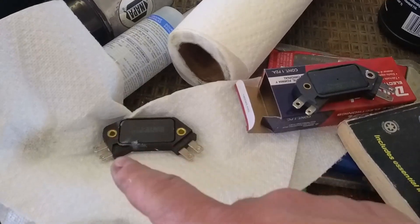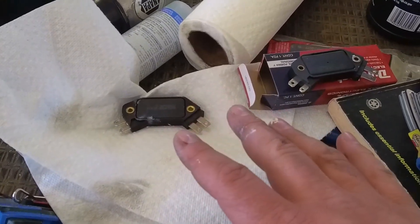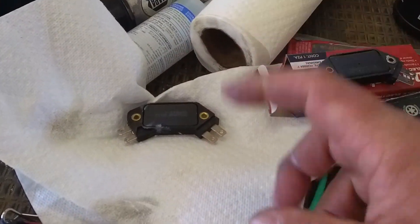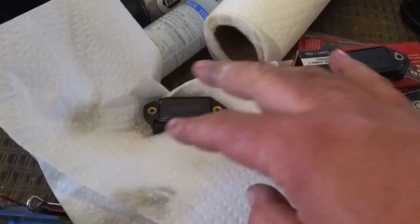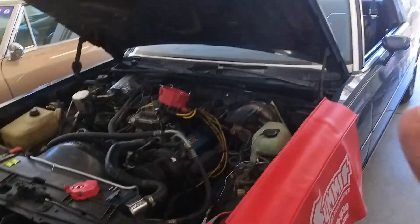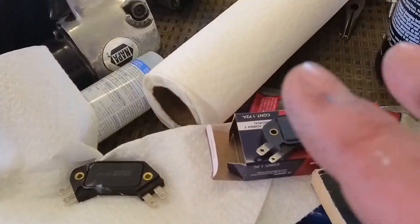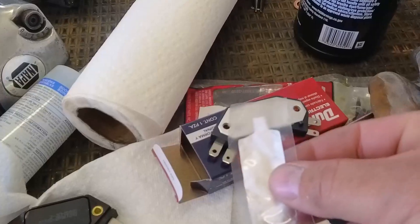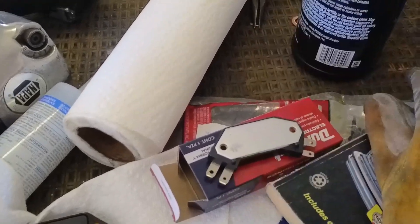This little guy's going to come out and we're going to pop the new one in. As always, comparing the old part to the new part. Word of caution: if your vehicle is like a mid-80s G-body or GM truck, a lot of them were computer-controlled and had oftentimes seven pins — four on one side, three on the other. This one is formerly computer-controlled but is now all mechanical, so it's the four-pin style module. We're just going to turn it over, squirt the heat paste all over the bottom, give it a wipe around, and put it back in its place.